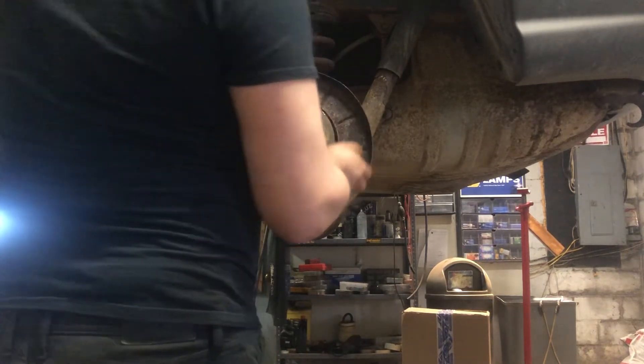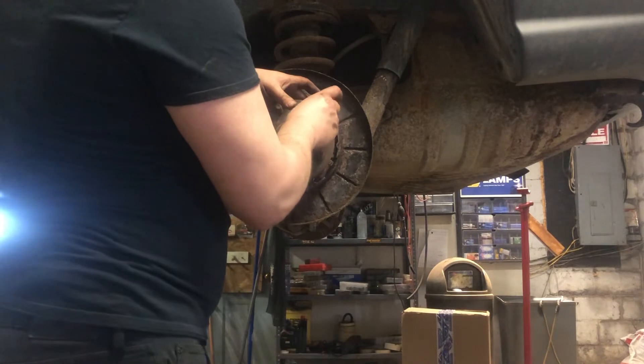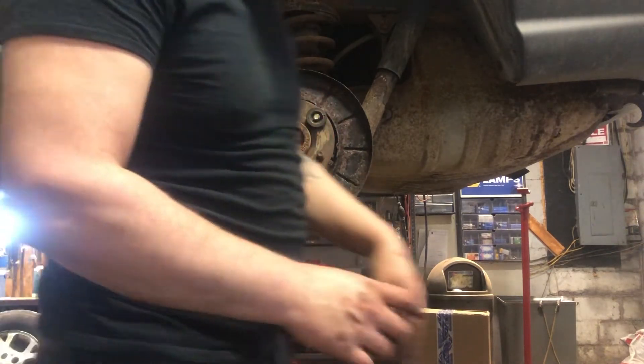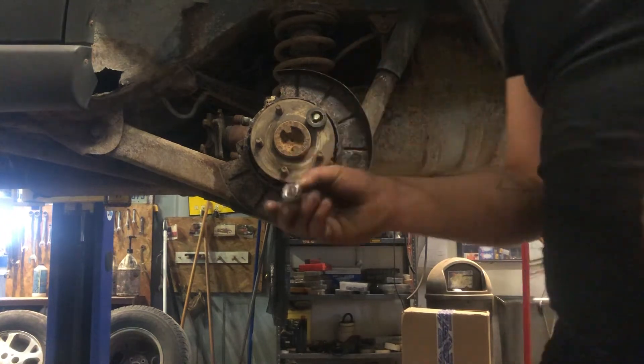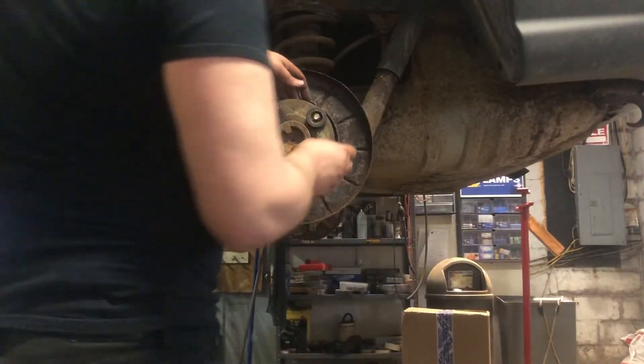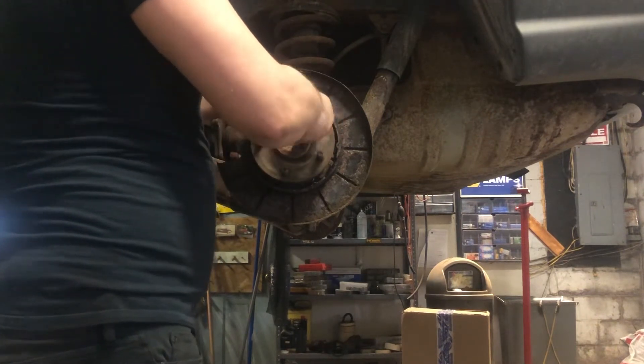You can do this with an oversized nut and a washer, but it's not real safe. You can end up stripping the threads on the stud or the lug nut. I did it a bunch of times back in the day and had a high success rate.